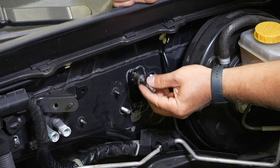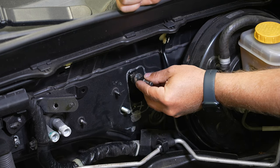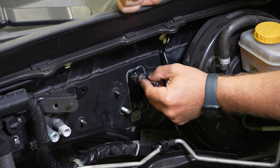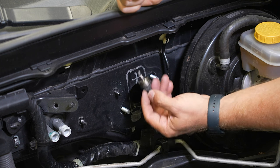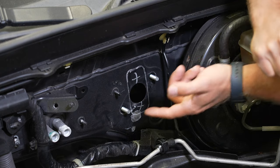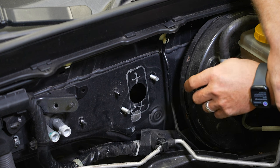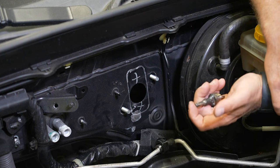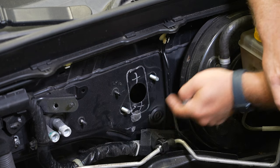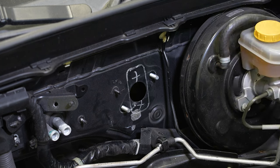But so we're gonna eye this up so when the pilot drill goes through, the radius ends up right on our line. And then what we're left with is 4 holes in here, and then we just have to cut out the little pieces that are left holding it on. So it makes it pretty quick and easy versus trying to cut that radius with a saw blade. I mean, A, you'd have to have a really tiny saw blade. I know they have a little pneumatic saw you can use, but the other option is just a cutoff wheel. You can do the same thing and just come in here with a cutoff wheel and nick each one of them off. But many ways to do it, but either way, we got to get that sheet metal cut out.